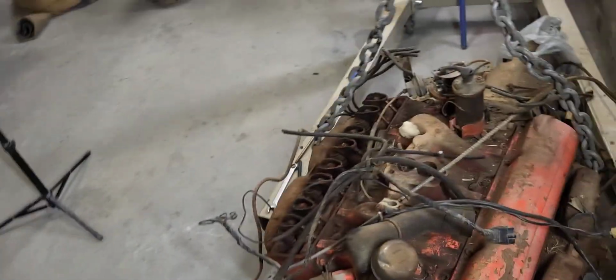So most likely I will not be using the generator / power steering pump. It runs on 6-volt. So I'm going to have to switch it over to probably, most likely, a 1-wire 12-volt alternator and run all new wiring through the car for the new 12-volt system. And another thing, something I'm going to have to contend with.